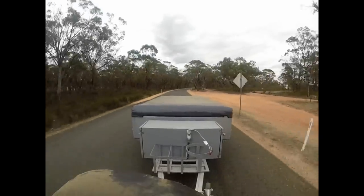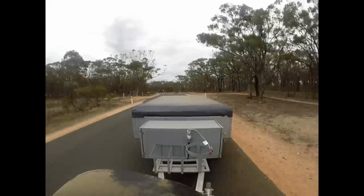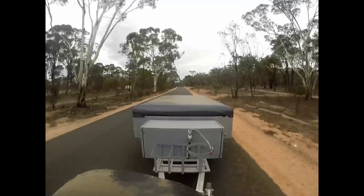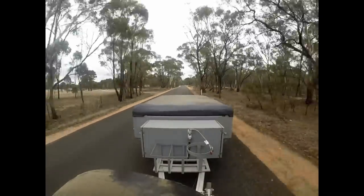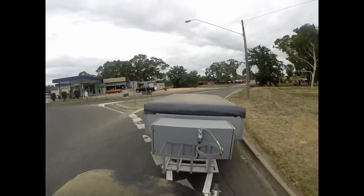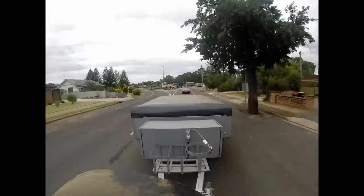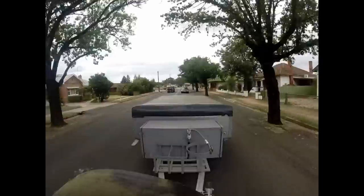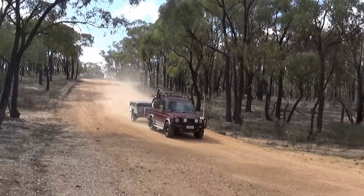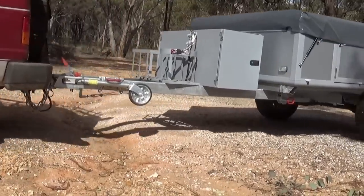This camper has a tare weight of 990 kilos and an ATM of 1450, which is perfect for a four-wheel drive like ours — ours can only tow up to 1500 kilos, which can make choosing a camper trailer difficult. The Aussie Opus has seven leaf off-road suspension and 10 inch electric brakes with off-road magnets. The chassis is galvanized and the drawbar is a 100 by 50 millimetre extended drawbar. The wheels and tires are 15 inch alloy wheels with Dunlop all-terrain tires. The box size is 2000 by 700 millimetres and the length from hitch to tail lights is 4900 millimetres, with a tent size of 5750 millimetres.